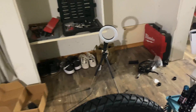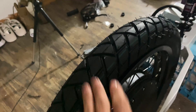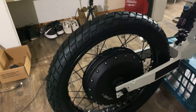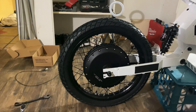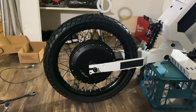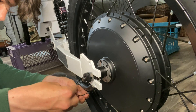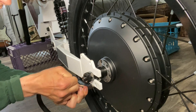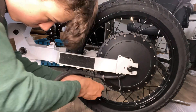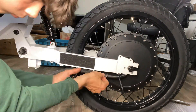These tires are totally insane — they have really nice tread, they're super thick, super wide, and I'm overall impressed. Next, we're going to route the cable through and up into the frame. To do this was easy — I basically just zip tied it to the bottom of the swing arm through these little designated holes, then ran it along the bottom of the swing arm and up into the hole I made in the frame.